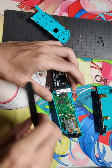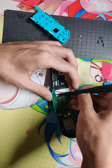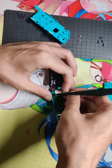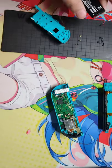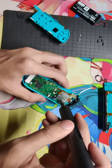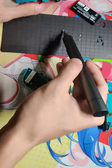Next you should kill the battery first — I don't mean 'kill,' I mean take it off first before you do anything else. The battery is quite easy: just pick it from the underside and it will come out easily. Then for the joystick — not the Joy-Cons, the analog stick, sorry — there are another two screws.